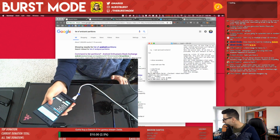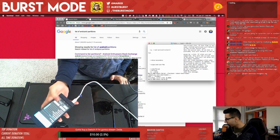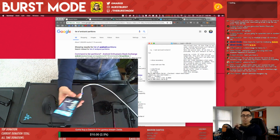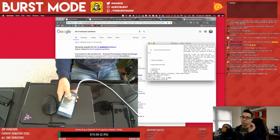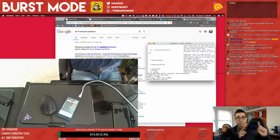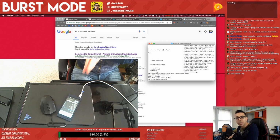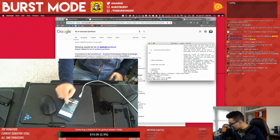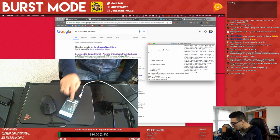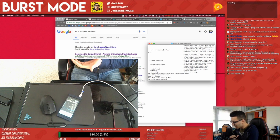So you can choose folders to back up, where you want to store them, all that stuff, and hit swipe, and it'll do a full backup. And what that means is, this isn't just, oh, here's your stuff set aside in a folder. This is a complete image file backup of what's happening on the device right now at this moment. That means the boot, the system image, the data, the cache. You can include all of those things in there. It's not going to include things like the recovery. It's not going to include other device level stuff.